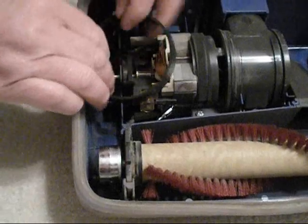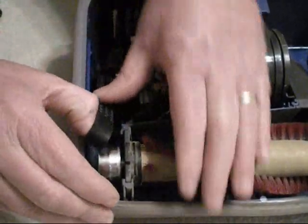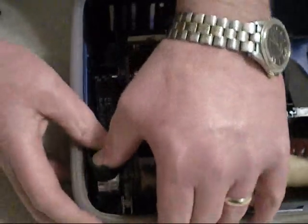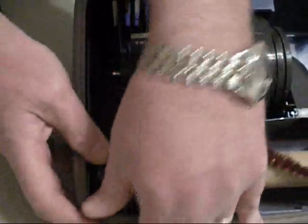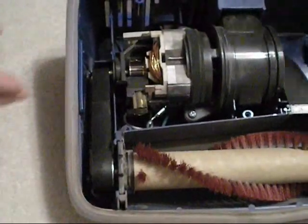Now to put the new belt on, you just do that in reverse. Slide the belt down past the motor shaft. Stretch it up over the pulley. And just roll the belt forward with the roller brush. And it's on. Then you'll put the bottom cover back on